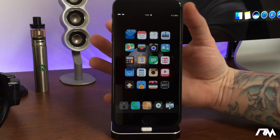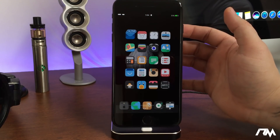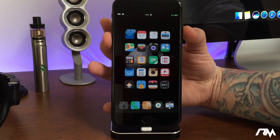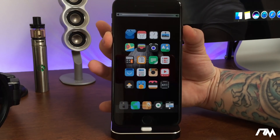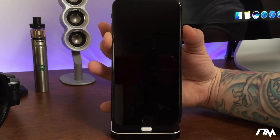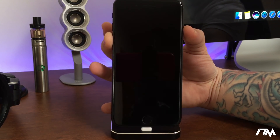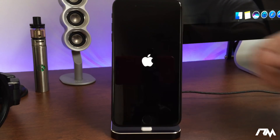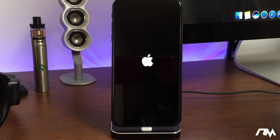For those wondering: a hard reboot on the iPhone 7 and 7 Plus is pressing the volume down and power button both at the same time. Hold both buttons until your device turns off, keep holding until you see the Apple logo, and then your device is booting back up. That is a hard reboot on the iPhone 7 and 7 Plus — so just give it a minute and keep holding.